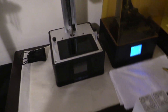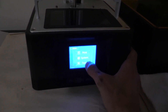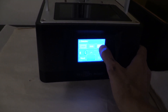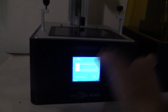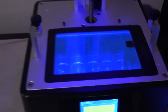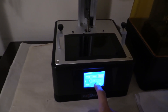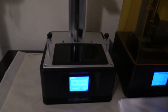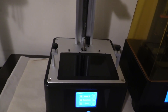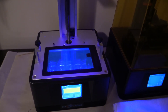It's a bit of a mess over here, but here it is next to my Anycubic Photon Mono 4K. I plugged it in — the device still turns on. Now we can go to Tools, then Detection, and turn on the full screen mode. Hit next... and it lights up. Wait a second — is that a whole section that's not lighting up? I just realized — that's the ribbon cable right there. Oh my. Oh crap.